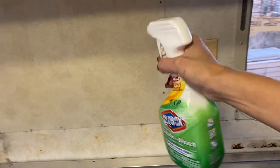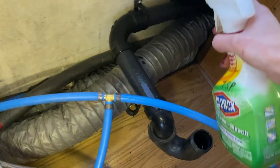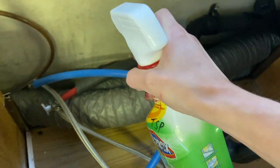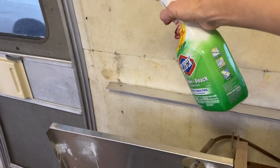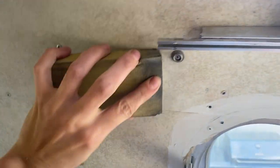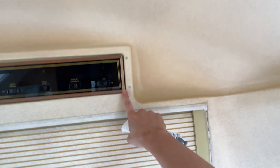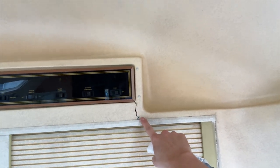The first step is to scrub away all the sticky grime that was built up all over the interior skin from the past 40 years. And I found that a heavy-duty household cleaner like TSP works pretty well for this. And then I prepped all the surfaces with imperfections like cracks and holes, starting with a crack in the front ABS plastic nose end next to the control panel.